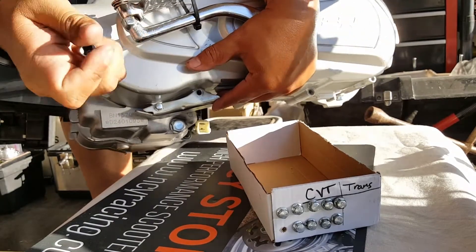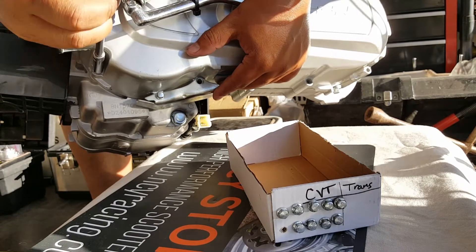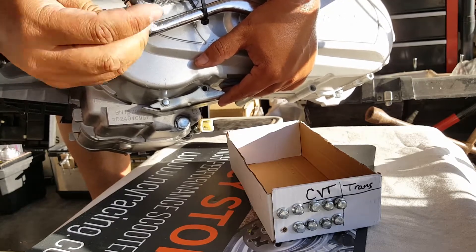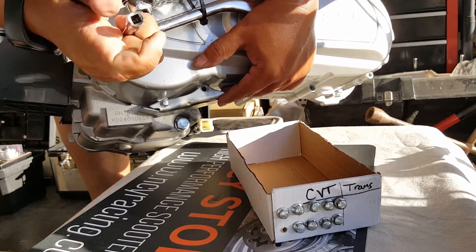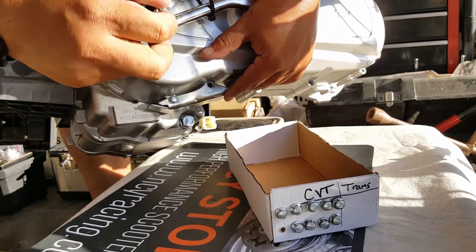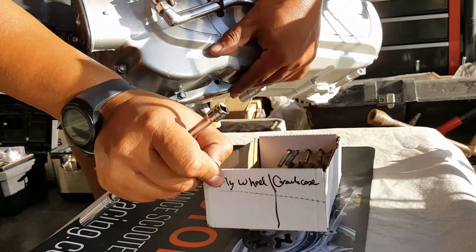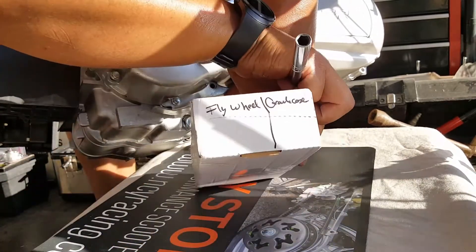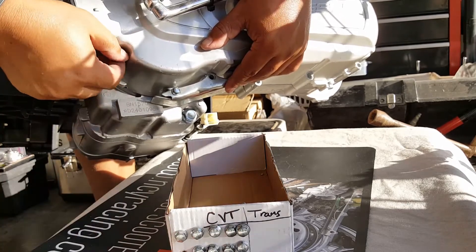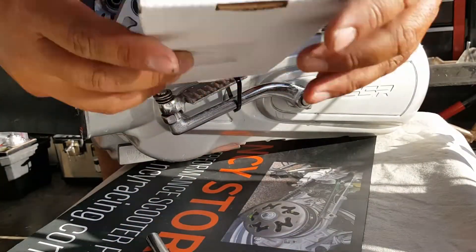While doing this, I also set the crankcase outside since it's warm weather here in California — almost about 100 degrees. Warming it up causes it to expand, and you'll see why we're doing that. I also freeze the bearings and crankshaft that we're going to replace. We need to remove the stator cover to get into the crankcase stator area. We made separate holes in the box for that too — once we get the cover down, we'll make the hole for the flywheel and crankcase. You can poke a hole with a screwdriver or a strong nail.